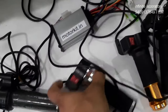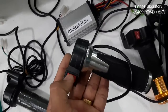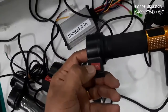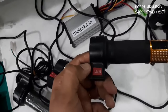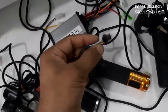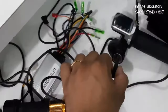This one is a throttle with a forward/reverse button, so if your motor is running in forward and reverse, you can use this forward/reverse switch. Another throttle has three modes — low, medium, and high. If you want to reduce the speed and your controller has a three-speed mode function, this throttle will be useful. It will have three different wires for the three speed modes plus the throttle wire.